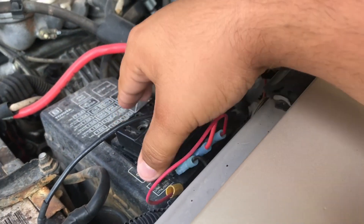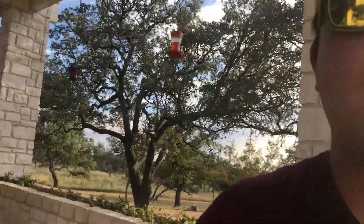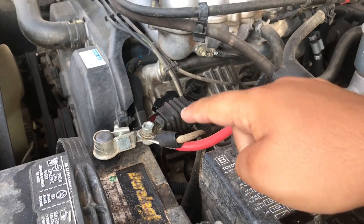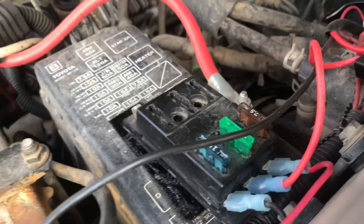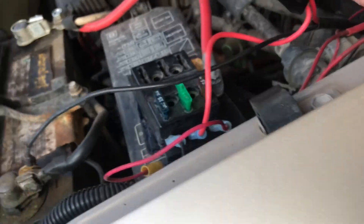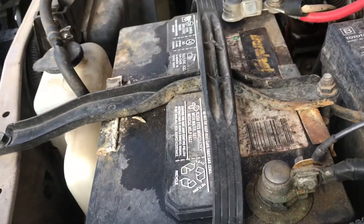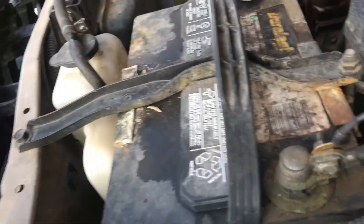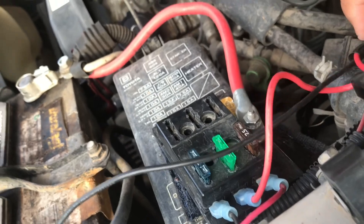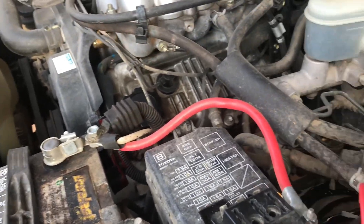They have this control panel that never sticks down onto the relay box for some weird reason — it just pops back up every time. Anyway, I have that control panel, which avoids me from going straight and directly connecting it to the positive side of the battery and just putting a fuse there. It already comes with the fuse in the harness, and it already comes with a hoop for connecting it straight to your positive and negative. For my application though, I decided to connect it to my fuse panel to avoid having too many wires on the positive side of the battery.